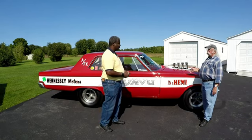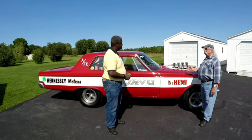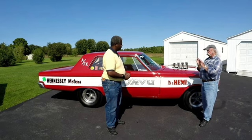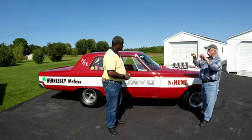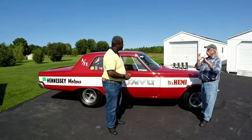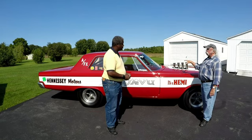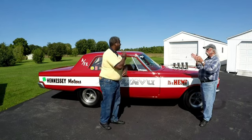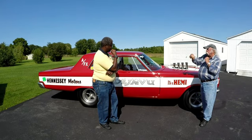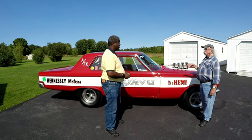I was out at the Mopar event in Las Vegas and bumped into a guy who had done it. I said, 'How on earth did you make this happen?' He said, 'It's blindingly simple — use the torsion bars and the K-frame. Find two pieces of hex stock 10 inches long, slide them in from the rear behind the torsion bars, get another torsion bar rear mount, and weld it together.' So the torsion bars think they're 10 inches longer — the mounts are 10 inches longer — and you maintain the parallel so they're not twisted. I flew home and we did it the next day, and it worked beautifully.